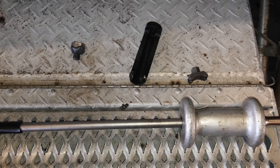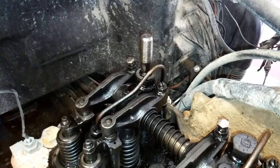Now you're going to need some tooling to do this. You're going to need a slide hammer. The black socket in the middle is a CAT tool. The tool to the right is for removing the retainer, and the tool to the left of the socket is an adapter from the slide hammer to the nozzle.